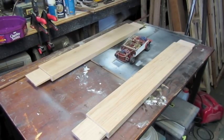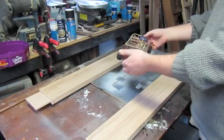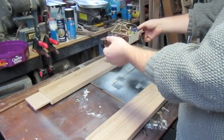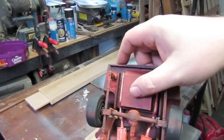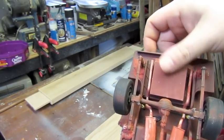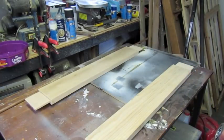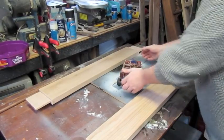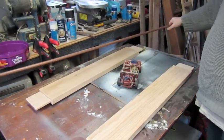The other thing to work out as well is, because this vehicle is quite heavy on its own, and with the body on top of that, it's going to have a bit of weight to it. So I'm thinking maybe get some brackets, attach the pole, screw it into the fuel tank, because that's the reason why I put the fuel tank on in the first place, so there's somewhere to locate the pole. I think that's probably going to be the best. I mean, it'll be epoxied to hell, but it might need some additional support, because it is heavy and I don't want it falling off, because that would ruin it all.